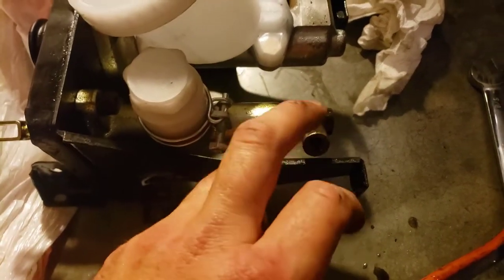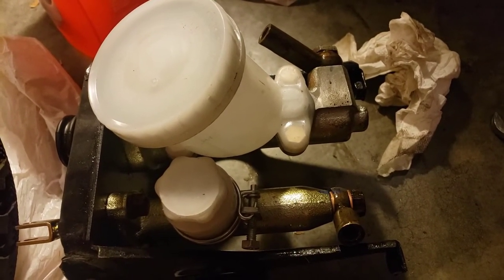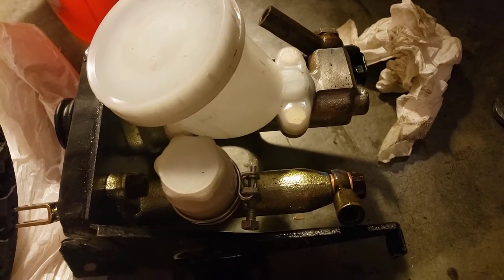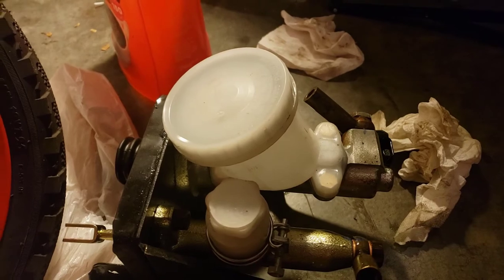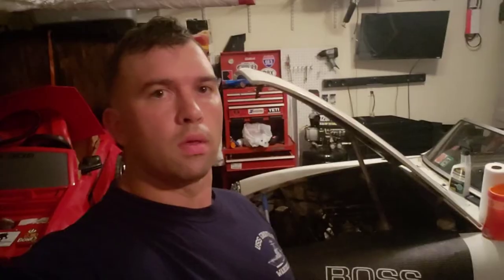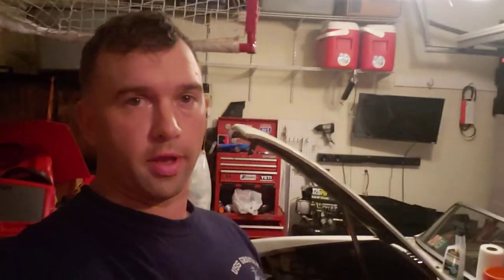Now I've got two washers on the banjo for the clutch, and the trap valve installed for the brake line. We're going to put it back in the car and bench bleed again — I'm going to take the fluid that I drained out and reuse it since it's fresh brand-new fluid. The car is all pieced together now. It's pretty dark in here; the camera makes it look brighter than it is. The car is all buttoned up and we're going to fire it up since it hasn't been running in a while, then feel out the pedal.